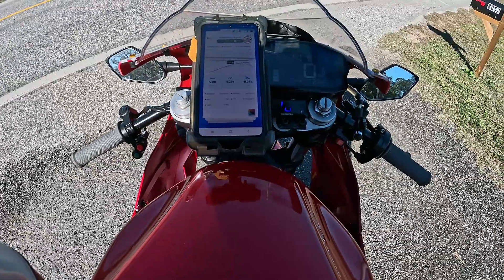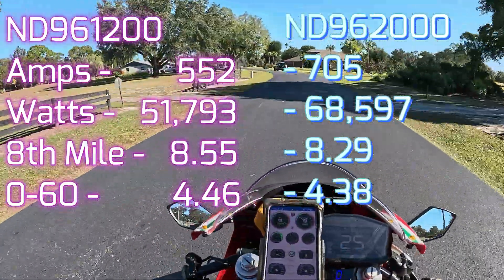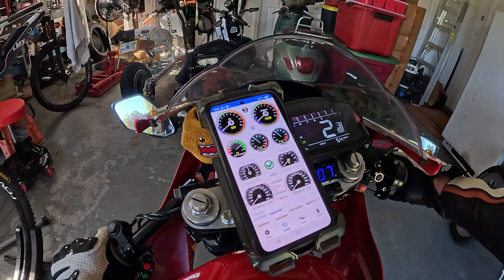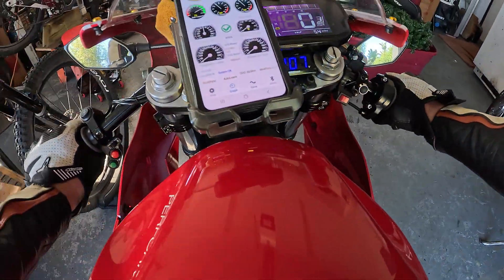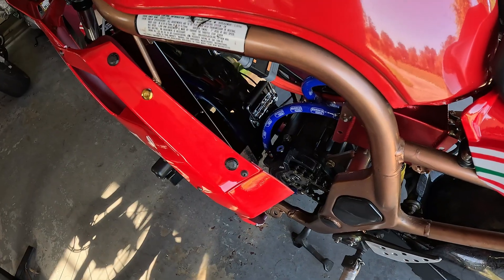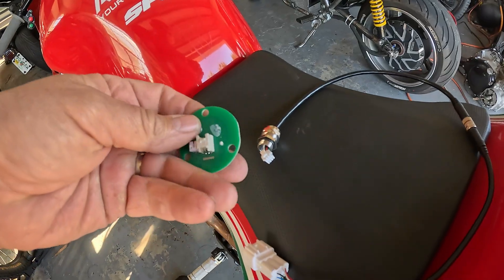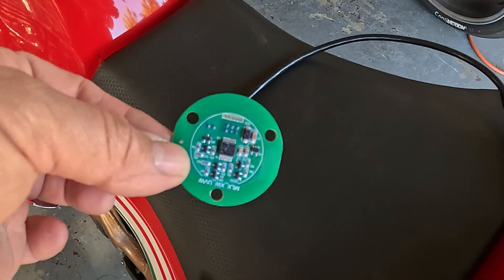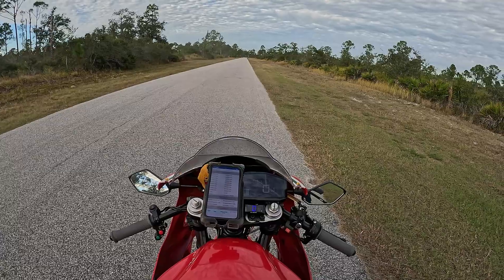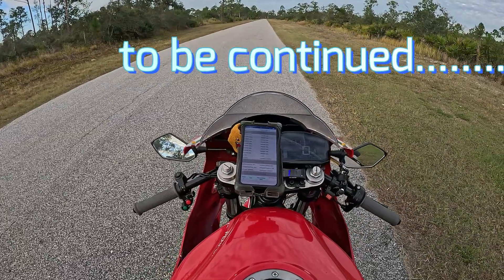I just don't think this motor can take that much power like the QS 268 can, and that's not a complaint. The motor is advertised at 20,000 watts and 40,000 watts peak — I peaked at about 65,000 watts on that one, so definitely not a complaint. I know I'm going to get comments saying a motor can take as much power as you give it — I don't disagree, I'm just saying the motor ain't taking it. Everything's open. The Socheon GTS 35 claims to be a hall sensor motor. The hall sensor plugs into your controller and goes down into the motor, but I'm not sure what that connector is. So this is going to start a whole new video on how to get more low end torque. Everyone in the Far Driver group and the electric bike build group on Facebook is struggling with getting a Far Driver to deliver amps quicker so the bike is quicker.